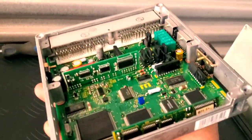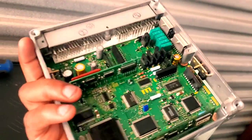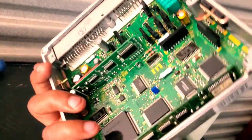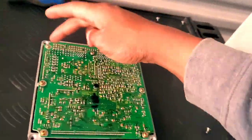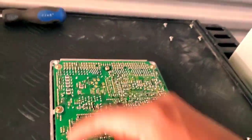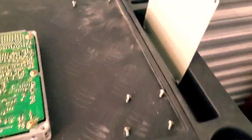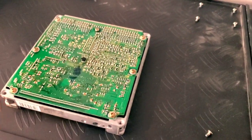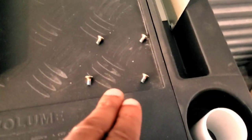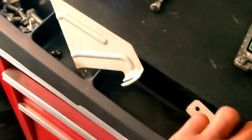Pretty much as you can see, it's pretty simple to reveal the actual ECU itself — just screws on the outside of the case. Now in order to take the actual ECU chip out, because this is a drop-in ECU, there are seven Phillips screws on the back that hold it in to the casing. I like to be extra careful since this is the ECU — I left all the screws in the order they came off.